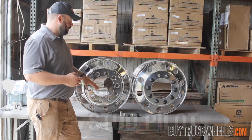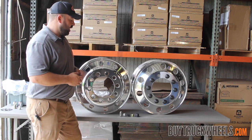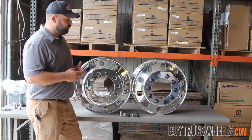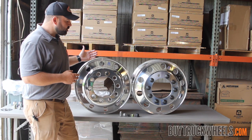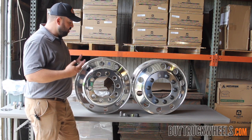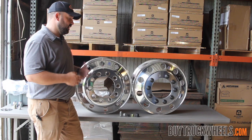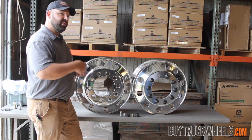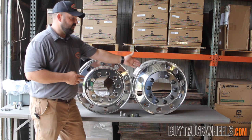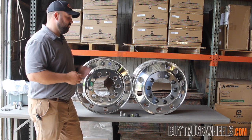You obviously don't have your wheel off of your truck all that often to be able to see this, so another way to determine what type of system you have is by looking at the lug nut. The stud piloted system was used more frequently pre-2000. If you have a newer model truck, that does not mean it's always going to be hub pilot — it still could be stud pilot — but more than likely on anything built post-2000, we're going to have the hub piloted setup. Pre-2000 doesn't mean you have to have stud pilot either; it could have been hub pilot.